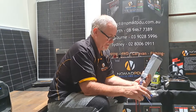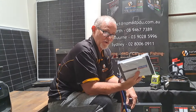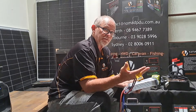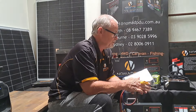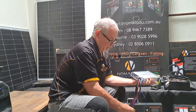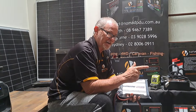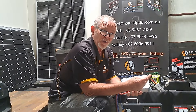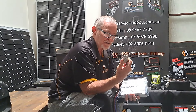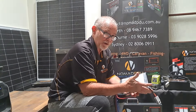That can also run this at 40 amp, and then you've got a solar input here. On the top of this van we're probably going to be running about 450 to 500 watts of solar panel, and this unit will regulate that at 40 amp. So basically while driving the vehicle charges at 40 amp, and on a sunny day with 500 watts of solar you're going to get up to 40 amp — you're probably never going to run those batteries flat unless you park in a cave. The vehicle input connects here through to the crank battery via approximately a 70 amp rated cable. Make sure you rate the cabling well — the instructions specify at least 70 amp — and fuse it between the crank battery and this unit for safety.